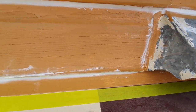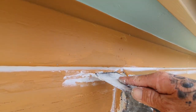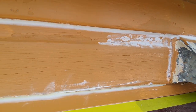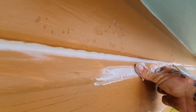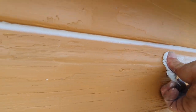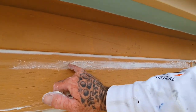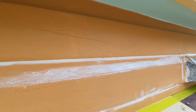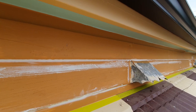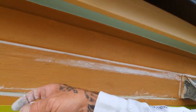See, when you're doing it like this with the blade, you're not filling the complete entire thing because you are scraping it out as you go down. But if I've done it like this — see how you're filling it completely in — when it comes to sand you don't really need to do much at all because it's already completely smooth. All you're getting really is any little high bits that you've left behind with your filler and you're pretty much ready to go. So you're going to save a lot more time than trying to use your blade, and you're going to fill up 50% more of any lows by going sideways across rather than scraping it downwards.